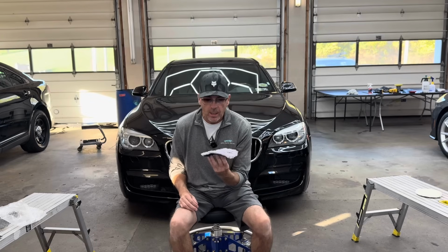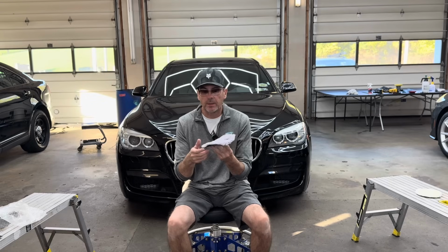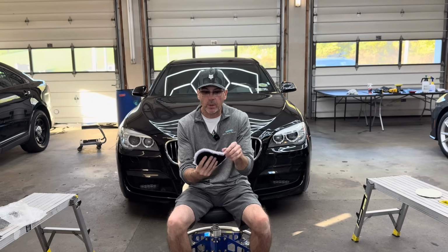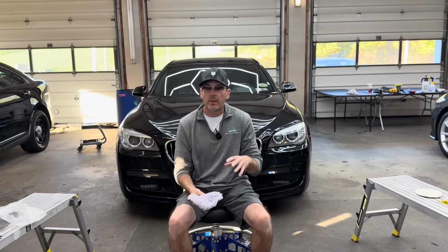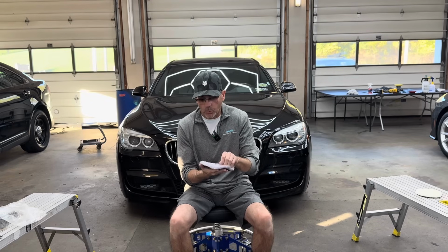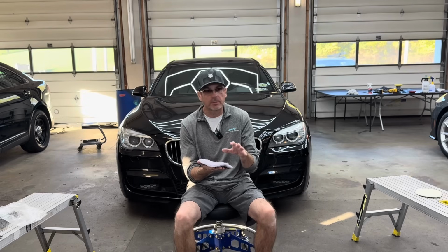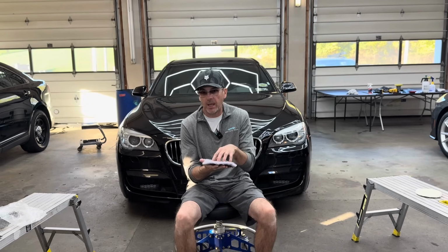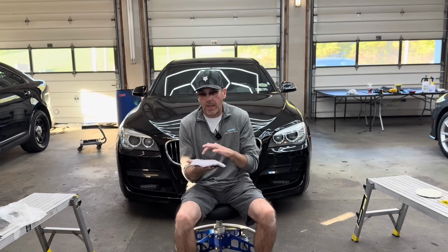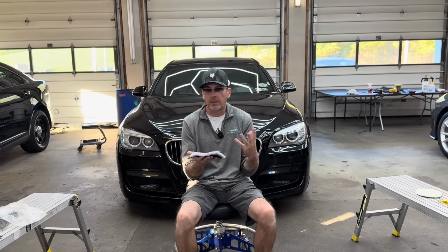Now, on medium to soft clears, I'm going to grab another type of wool pad made by Lake Country, but it's going to be the purple. They do have a blue one as well, but this purple one right here has nanoparticles within the foam structure of the base, where the wool is knitted to, that keep the fibers from getting matted down. I kept one before I cleaned it off that I used for 3 passes, or after loading up the pad 3 times and working on a panel. You can see some right here in a small area are matted down a little bit, but the rest are still kind of standing up. They're free from tangling around each other.